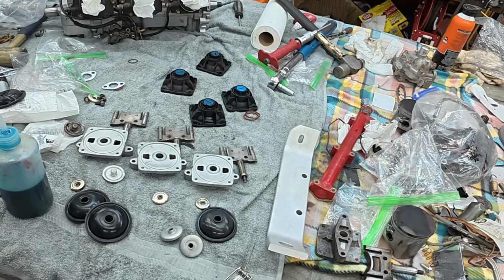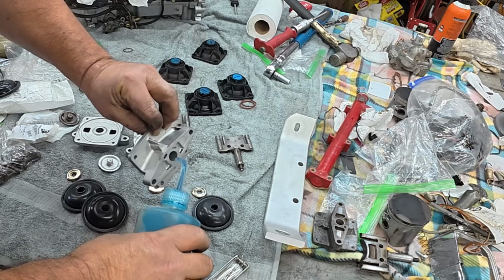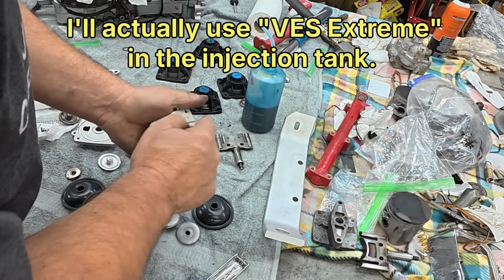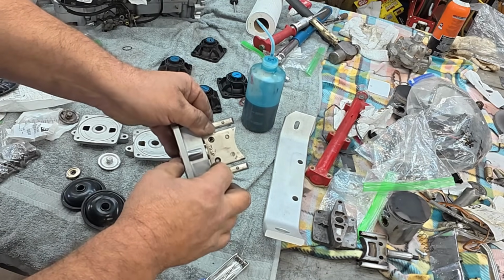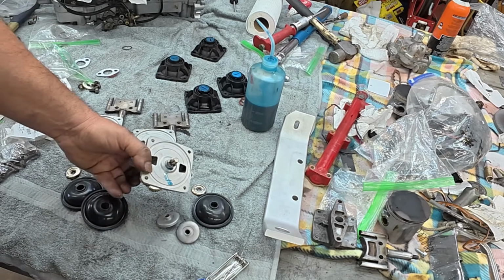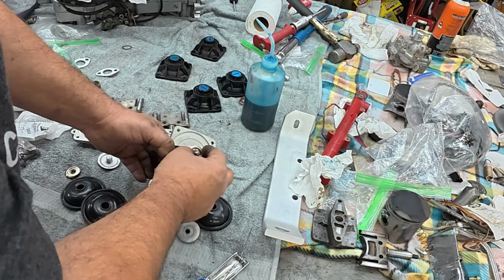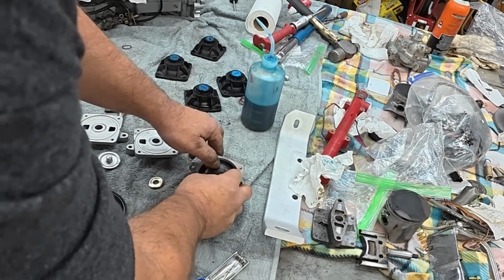All right, so you can see I got all my exhaust parts laid out, and we're going to start putting it together, give it a little bit of lube. I know it calls for the gold, and I'm using the blue. It'll be fine. So up goes on the side with the dowel pin, and it literally says 79 up. So you know you got the right slide for the right motor. Got some oil coming through there. That's a good thing. Wipe off the excess a little bit. Okay, now you got this beveled washer, then your cup, and then I'm going to Loctite it.